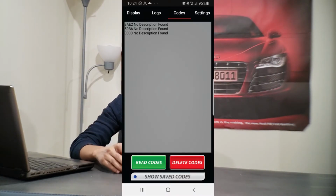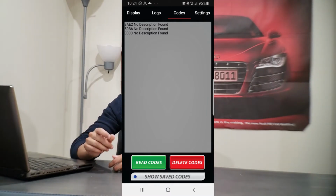As you can guess, a lot of malfunction lights came up. I used the JB4 to pull the codes, but it didn't translate what the codes were exactly, so I ended up trying to pull the codes with my Unitronic cable, and a lot of it came up as O2 sensor bank error. What else was there? Transmission error. Basically, it was an array of errors.